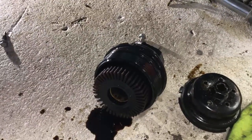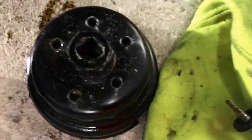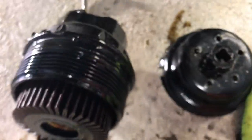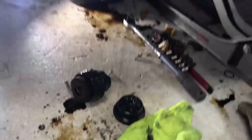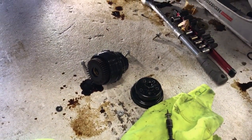Just keep that in mind: when you go to take this off you've got to bend that tab out of the way. And if you break it and can't get it off, I basically pre-drilled these holes and ran some self-tappers right into the bakelite plastic, and got myself out of quite a bit of a jam there.